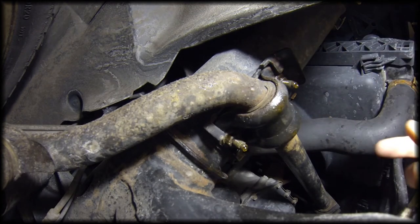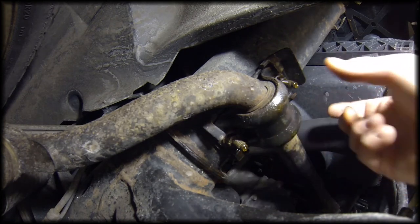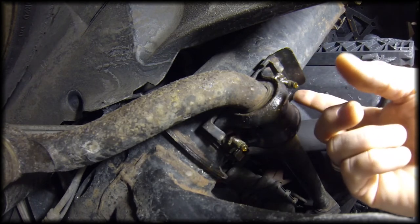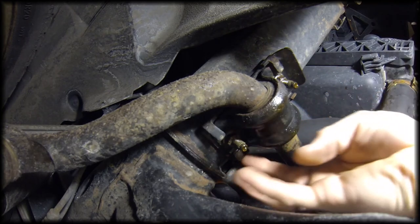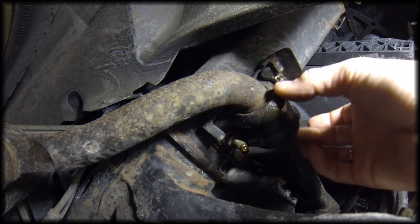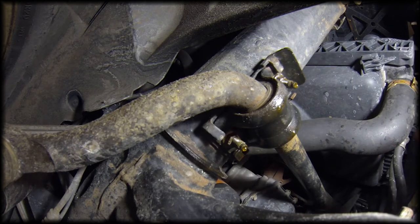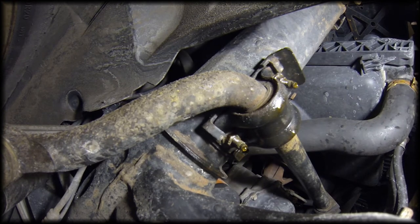The first thing we're going to do is remove these bolts. If you haven't done this before, there will probably be a couple of retainer clips right here. I had to break mine off because I've changed these before — I broke one off on one side and one on the back side so I can get the clamp out. You have to bend those out, and mine broke when I tried to do it the first time. But it's as simple as taking the sway bar bushing off, putting the new one on, and we'll see if that solves the problem.